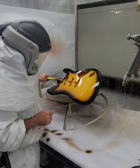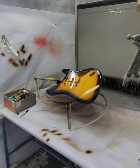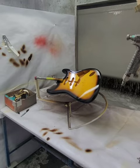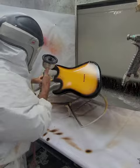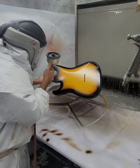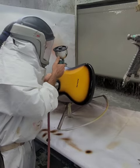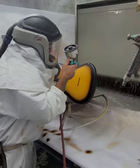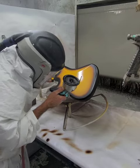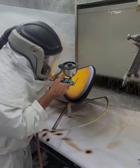It almost shrinks. So in order to counter that, I'm going to add a little bit more paint — just enough to go around one more time. In order to counter that sort of imperfect look, I put the lacquer on there to sort of force it to shrink, then I barely pull the trigger and aim just inside of the fade on the dark part, letting the edge of my fan soften that edge even more — not trying to make it any wider, just trying to make that inner fade a little more uniform and soft looking.